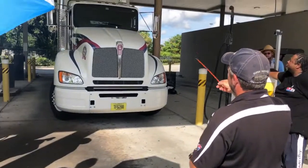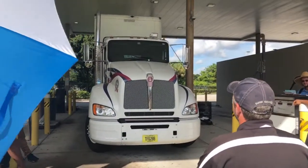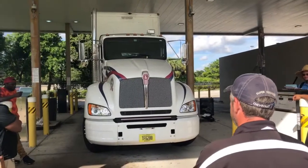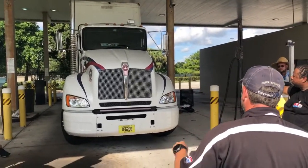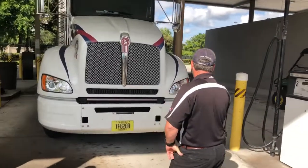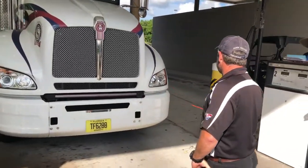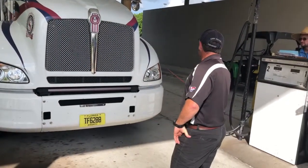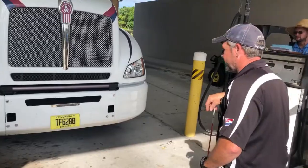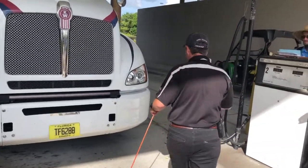I'm going to check the actual lights on top of the cab — they're all proper color amber, not cracked or faded, and there's no moisture inside. I'll check for operation when I do my light check. I'm going to check my front headlights here. They should not be falling out of the truck — securely mounted, no cracks in the lenses, no fading, no fogginess, no moisture inside. Make sure the side reflector is proper color amber, not faded or cracked. I'll check for light operation in a little bit.